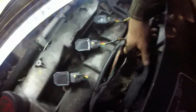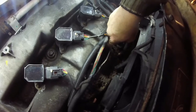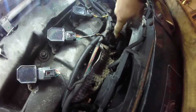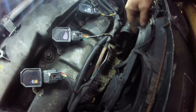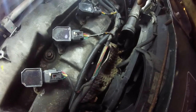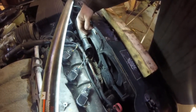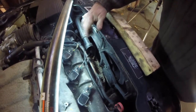This right here is the front cat — you can see one of the bolts right there. What you can do with the front cat is pull it back with a pry bar, but first you have to pull this bracket off. This is the engine mount bracket. You have to pull the radiator tube — it's just a clip, pull it out, it comes right out. It doesn't spew out too much coolant, maybe a pint or so. You also have to pull the airbox and air mass meter, which isn't hard.